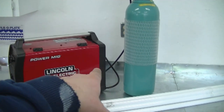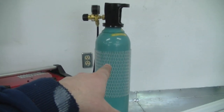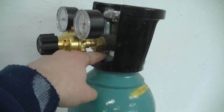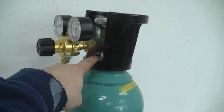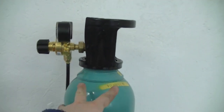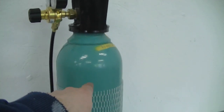The cylinders are also going to be chained up to the rack. Another tip: I'm going to disconnect the cylinder from the welder when not using it and store it somewhere safer. If the valve on the regulator breaks off, the cylinder can apparently shoot off like a missile. Keep it away from heat, keep it where it won't get damaged, and chain it to something secure. When I build the rack I plan on making videos showing how I do it.